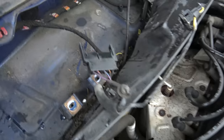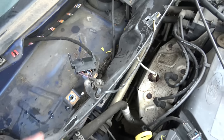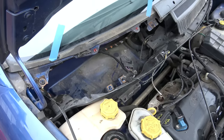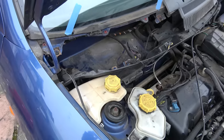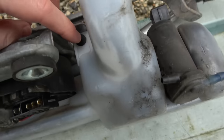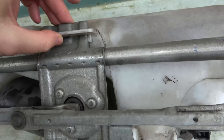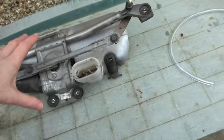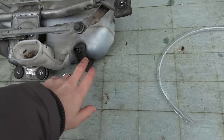Now we can take it all out and work on it. Everything looks very nice, clean and dry in here - no signs of rust, which is good. We'll wipe out the leaves before we put it back in. We now want to give the bottle a real good clean and find out where the blockage is. Looking at it, we're going to get the motor off first - it's held in with just one little screw here, and then it looks like it's clamped into the back of the washer bottle.